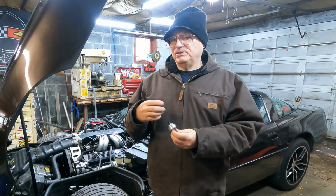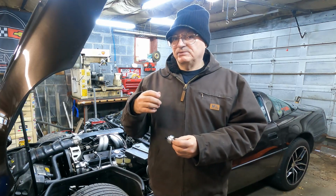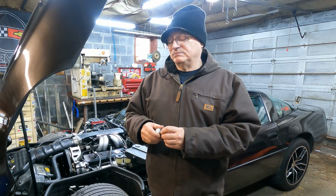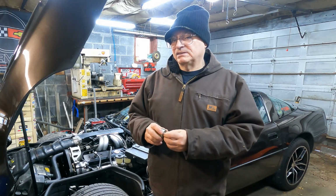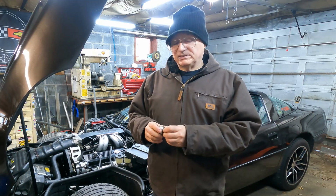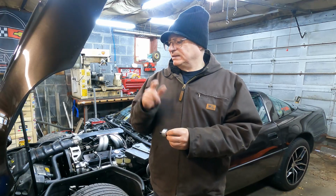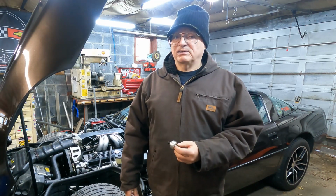The fact that I'm getting all these knock readings at idle, like I can just sit there and rev it up at idle, not even in gear, and you see the knock counts go up, tells me pretty sure they're false knock counts. So I got to do stuff like that. Meantime, I'm gonna go ahead and get the garage warmed up and then get things going.